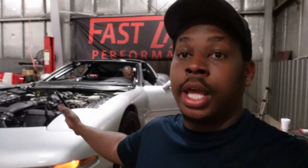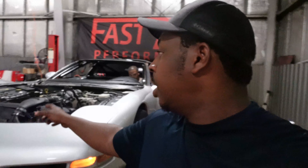It's an LS1 motor — or LS6 — with simple bolt-ons: headers, a mass airflow sensor, and a couple other basic things. In his class, the limit is 380 horsepower to the wheels, and you have to show dyno sheets proving your car isn't above that. Taylor's dialing it in. The car ran decent before but would shut off and do funny things. He's already done a baseline pull and the car is extremely rich, so there's a lot of tuning to do.